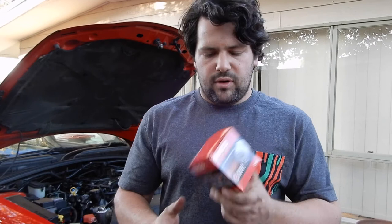Now that the oil's been drained, what I'm going to do is put in a new filter. This is a Ryco filter — they're made in Australia, very good quality product, probably better than OEM. This one, the code is a Z160, perfect for an LS1 engine. So we're going to chuck this in, get the old one out, put this one in, and then we will start putting in the new oil.